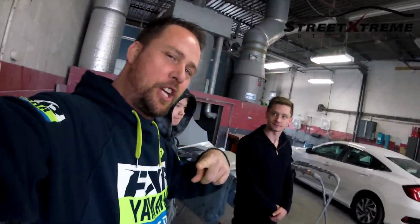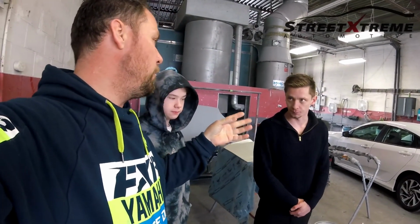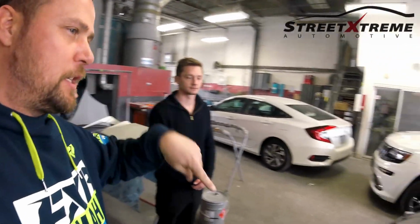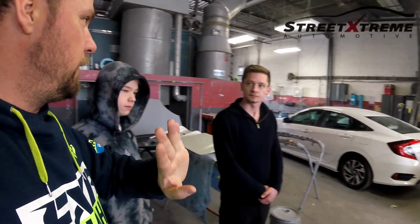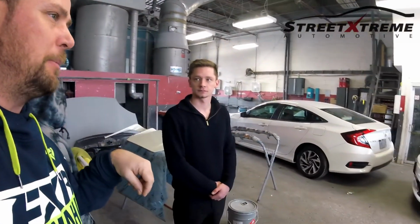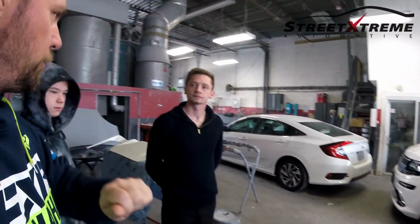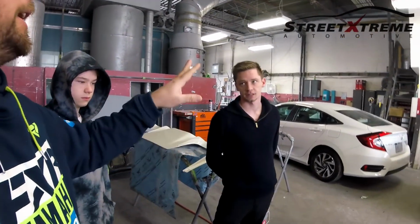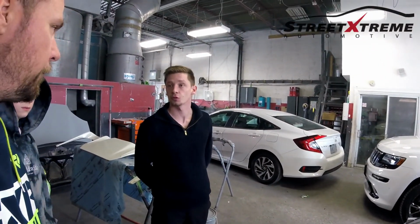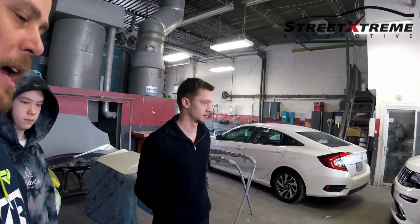So we were just checking out the other side, where it was the detailing and somewhat preparing or disassembly or reassembly. So this portion here now is a little bit cleaner air, I would presume. Yes, it's a little bit more filtered, and this is where you really come down and clean the product before you start taping it and preparing and getting into the shooting process. Because the cleaner the car is before it goes in the booth, the cleaner it comes out in terms of dust. You don't want any contamination and stuff like that.